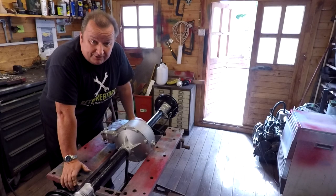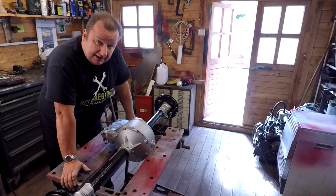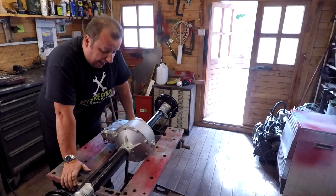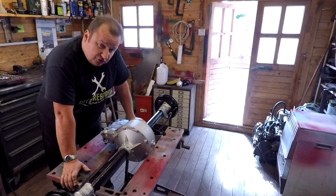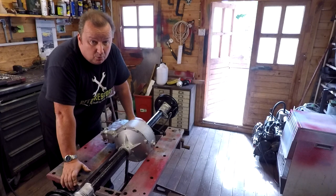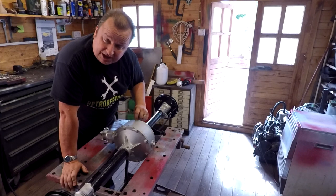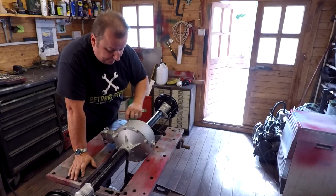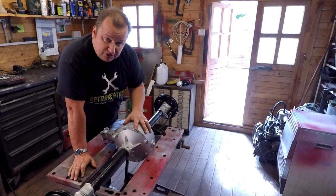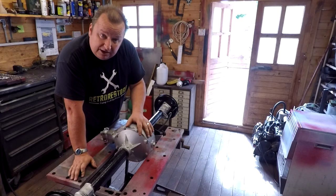As you know, we had the axle in the Reliant Regal chassis and all I had to do was plumb the brakes, the fuel pipe and stuff like that. But because it's been sitting outside for a good few months, I've only just realized that underneath on the floor, directly below where the axle was, there was a wet patch — and that wet patch was actually axle oil. It was coming out between the main axle body, and there are two paper seals that sit around the flanges which I never disturbed.